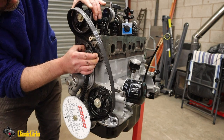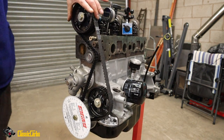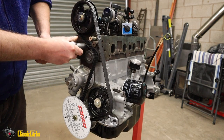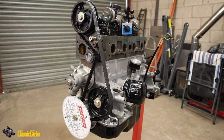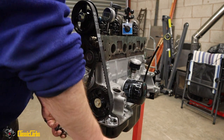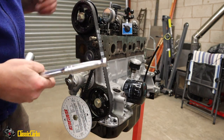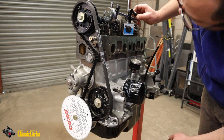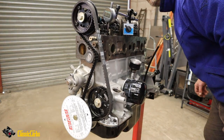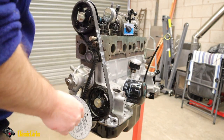Belt out. Okay, belt in. Good. Do you know I'm going to tighten that little push to this because I think this could be catastrophic if you don't do it when the engine is running. Okay, so we've moved one tooth forward. Let's get back to, so now the inlet valve's shutting. Oops, damn. Okay, well, that wasn't great, was it? Okay, it is at a bit of an angle, which is why we might be getting issues. So let's zero that. Oh no, should we zero it? Not yet.